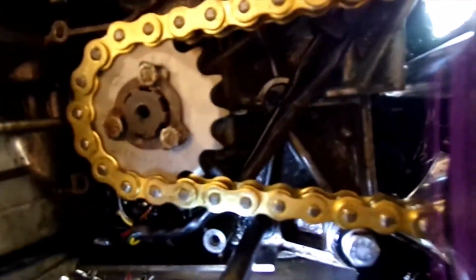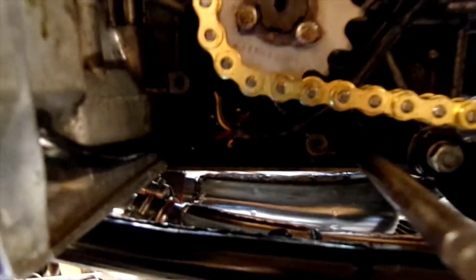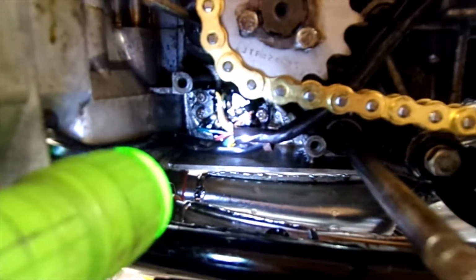Okay. Just changed that oil seal, O-ring rather, over. Dried that out in there as best I can. It's quite difficult to get to the back. I think I've got most of the old oil out that was in there, so I should be able to tell if that stopped leaking. Blown a bit of air in just to flush anything out. So we'll give that a few days and see how that looks then.